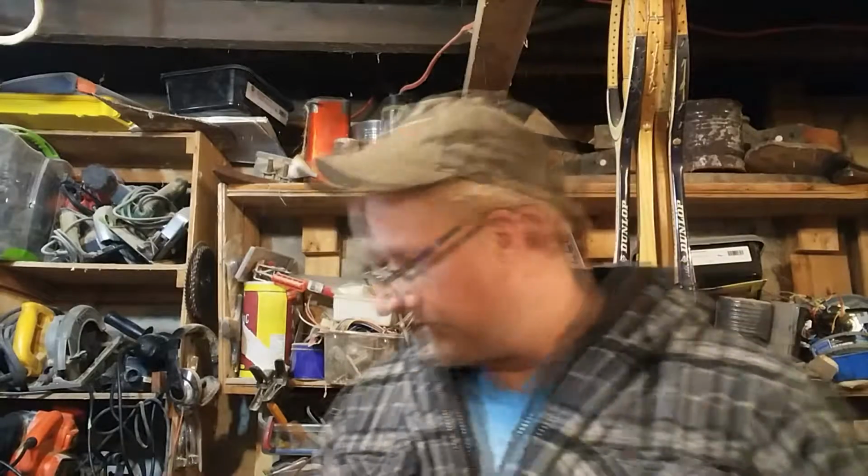Well, one of the factors is, do I have an actual cord that I can use to replace the broken one? I had thought, with all my near hoarding level of saving things, that I'd have a cord that would fit and would do the job. This one won't do. It's a nice heavy duty cord, 3-prong plug, but the drill is not 3-prong. So the neutral, the ground wire, wouldn't be connected to anything in the drill. And that one is set up to be used differently.